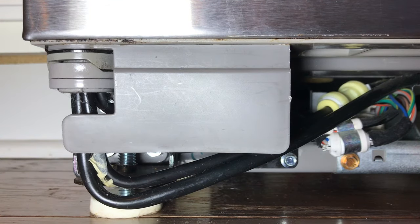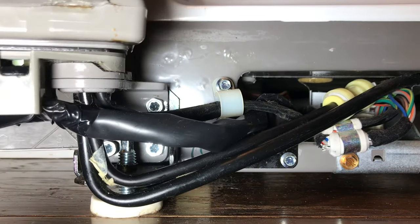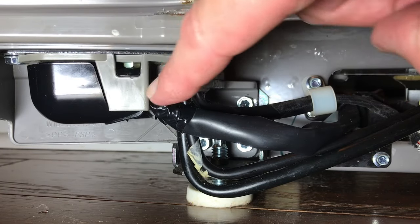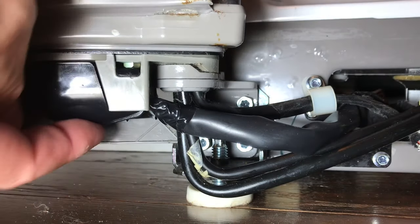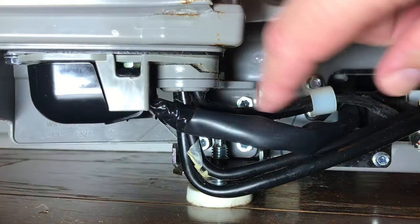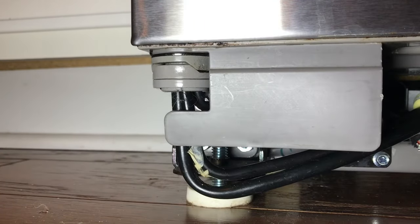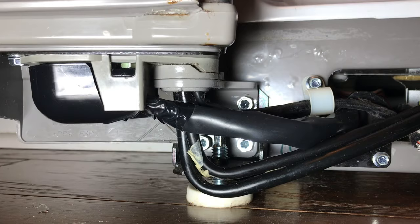Okay, I fixed the wires and connected them. When you open it all the way you can see it's loose - there's plenty of slack. I ended up taking this panel off - remember how I showed you prying here. I connected the wires together, taped them all, and they're actually inside here - there's a good ball of them jammed in there. There's plenty of slack in the wire now so when you open and close it, it doesn't bind up. That's all the way open right there.